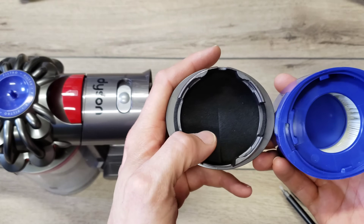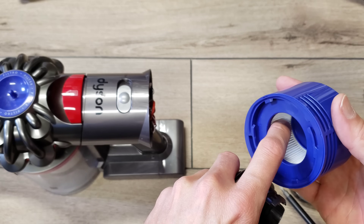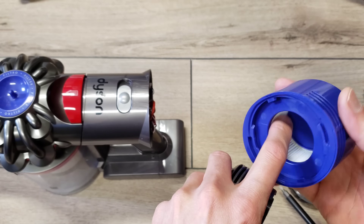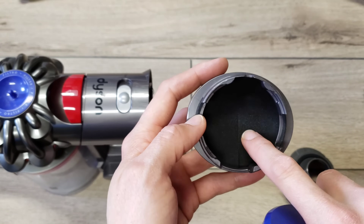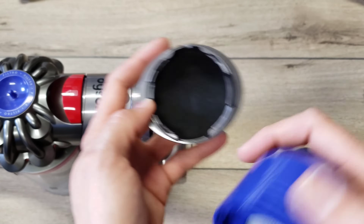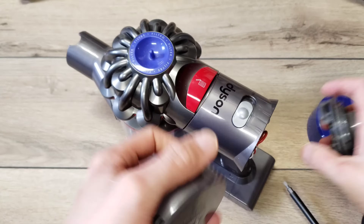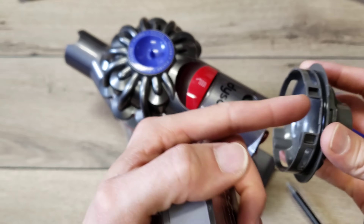Comparing the two filters, you can see how the HEPA filter is probably more airflow-efficient even though the filter media itself is more restrictive, simply because there's so much more surface area from the pleats. The original is just a piece of foam — as the vacuum is used, dust buildup will cause it to lose efficiency much more rapidly. Not only that, but the HEPA filter is easy to swap out afterwards without having to pry anything open.